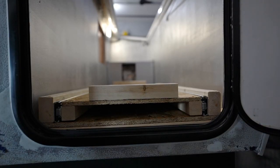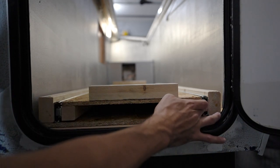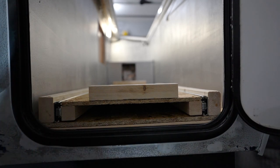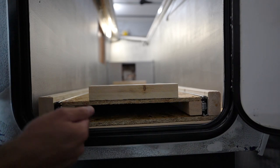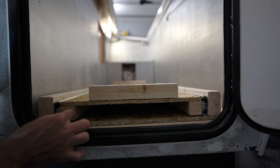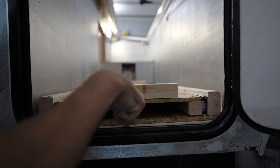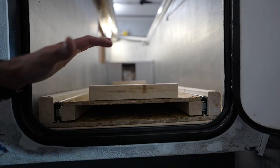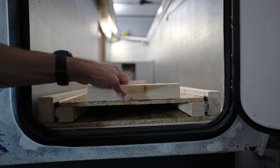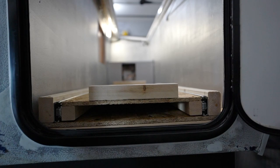If I have enough left I'll throw one more in the middle for a little bit more structural support. The only other thing I might consider is that these slides are not locking, so I might put some sort of lock going into the frame right here - maybe mounted on a bracket - so it goes straight down into the frame. That way when we're in transport this isn't shifting slightly and hitting that door on accident. It'll just be something to lock it in during transport.